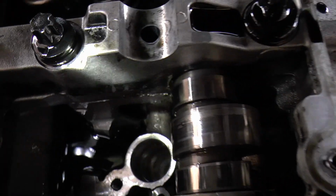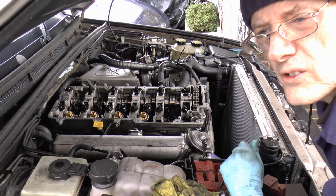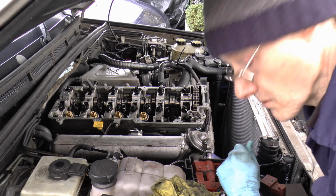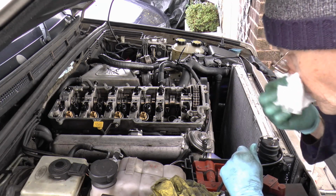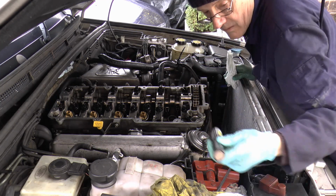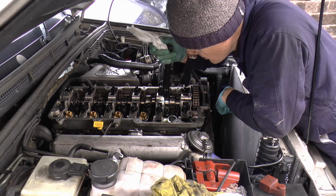Quite a complicated casting, isn't it, this head? Probably why they break so much. Well, the good news is, if you have a model 2002 to 2004 with the 15p upwards engine, it's a lot better. Because they fixed it. More or less. You're supposed to do the syringing after you've got all the injectors out. It's easier to turn over then. I'm not going to do that, so...